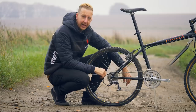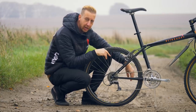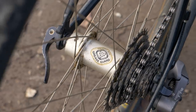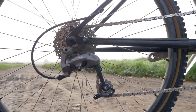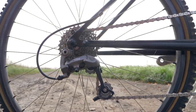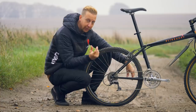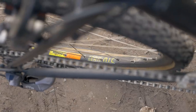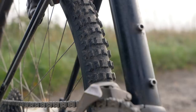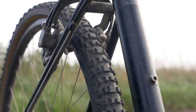Out back, it's also a 26-inch wheel on WTB Grease Guard hubs. The hubs are quite interesting because this was pre-cassette design — there's actually a custom cassette setup here: a screw-on block but an eight-speed block, still using a Hyperglide system with a lock ring, which comes from the cassette style we're familiar with today. Pretty cool to see. The rims are again Mavic SUP 117 Ceramics, with another Specialized Hard Pack 26 by 1.5 tire — quite perished, but really nice to still see them on the bike.